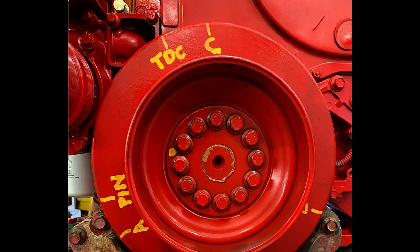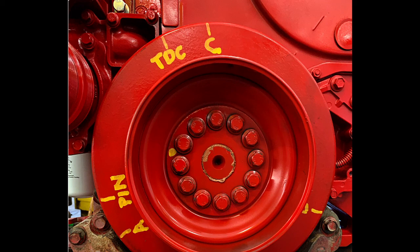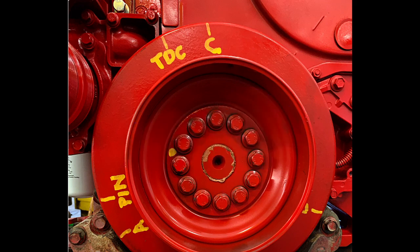Once you get some hours and miles on these engines, that damper will get rusted up from the salt and the weather, and then it's hard to figure out where the pin mark is or the A, B, C positions. But you can find the location of that dowel by finding just one mark. If you can find one mark, you can draw an imaginary center line from that mark — A, B, C, TDC, whatever — through the center line of the crank. Using this photo, you can see where the dowel pin in the crank is, and we learned earlier that the dowel pin has to be almost in line with the crank sensor over on the right. That'll help you get close enough to pin your crank correctly.